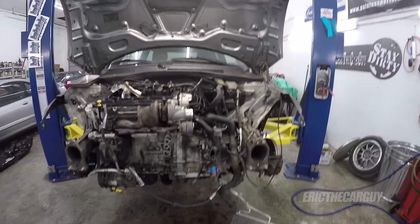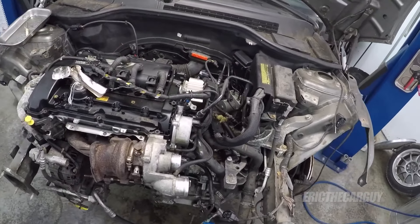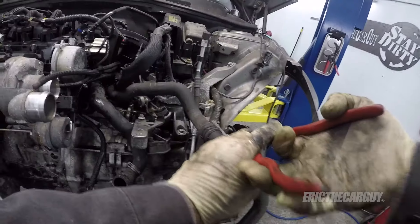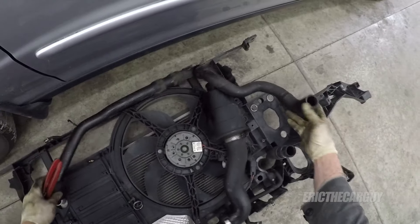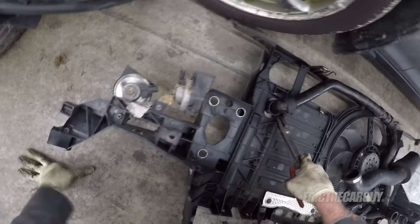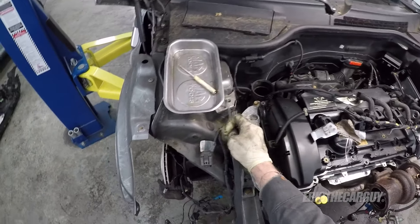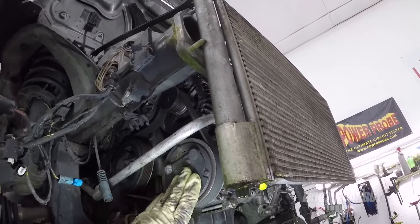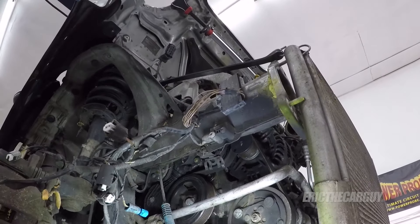Let's get to the action already in progress right now. Let's get this engine out. This long radiator hose was designed to go with the radiator, so I'm going to remove it from here and install it on the radiator. This AC line and AC compressor have to come off, and this is just connected on here by what looks like just a 10 millimeter. Looks like the drive belt just goes around the AC in this.